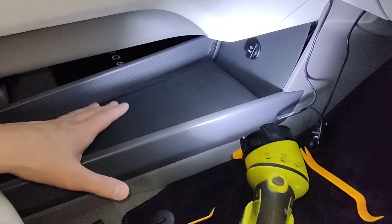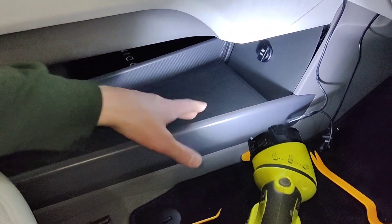One annoying problem is that because the USB port it connects to is constantly powered, the wireless Android Auto dongle never lets go of the wireless connection to your phone. So when you get out of your car and go home, it stays connected. I had to come up with a way to make it shut off when the car shuts off — essentially by connecting it to a switched power supply, generally the 12-volt port underneath the console.